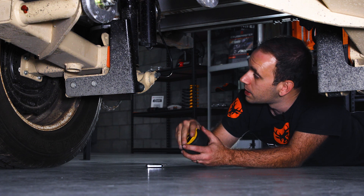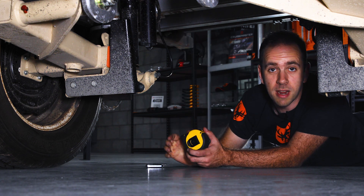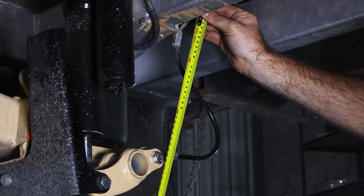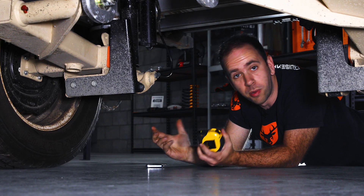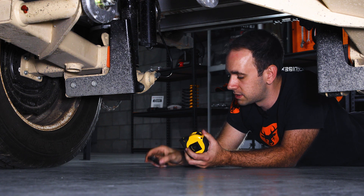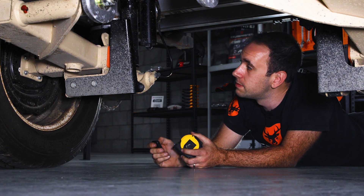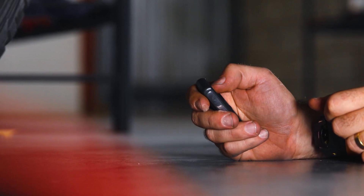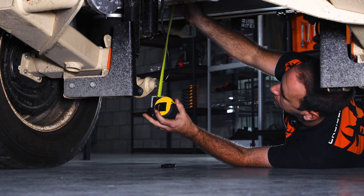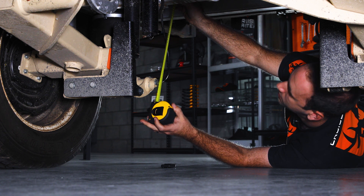On the ATX that we have here, we're looking at the distance between the two rear rebound cable mounts. We get our tape measure out and we're sitting at about 300 millimeters. We need to put some air in it to lift it up because the target we're aiming for is 360 millimeters. This is nice and easy because I've got the CruiseMaster wireless air control system, so I can jack it up here. That's about spot on within a couple of millimeters.